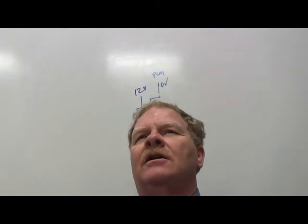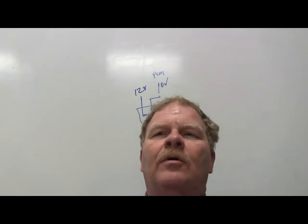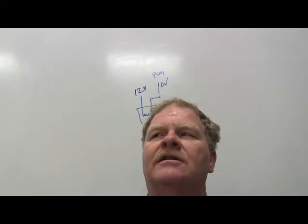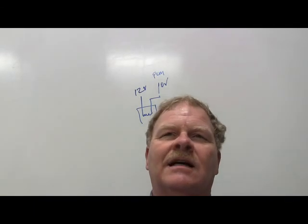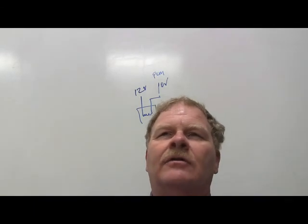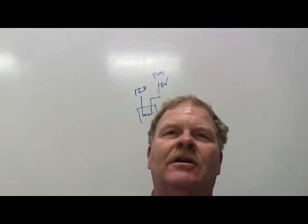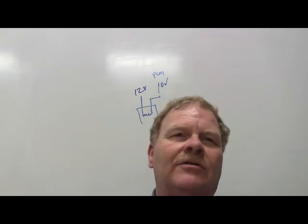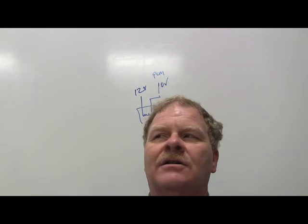Let's say that your air management system, remember we were talking about the air injection reactor? During part of that process, it's pumping air upstream, isn't it? What if the air injection reactor system fouled up and it started pumping air upstream all the time? The sensor is going to be reading that oxygen, which was pumped in after the exhaust came out of the engine. It's going to say, I'm seeing a lot of oxygen, so it's dumping extra fuel in there to try to take care of that. Well, it isn't going to be able to take care of it because it's not making any changes.